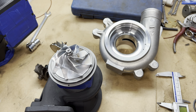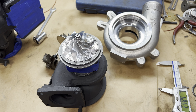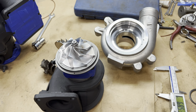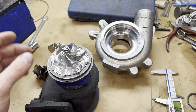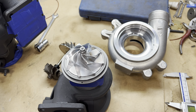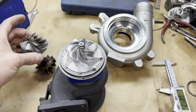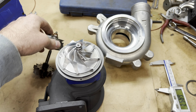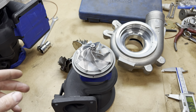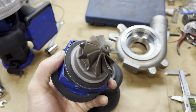I could look from the top side to see the clearance to the wheel — it's very time consuming. It took me from about 9 a.m. until a little after 5 o'clock before I was done with both housings. The inducer is no problem though; that's super easy to do on a CNC machine — I just have to know the wheel dimensions and the spacing, which I already know. To figure that out, just take your factory wheel, measure it, then measure the inside bore and subtract the two — that tells you how much bigger the housing should be than the new wheel.